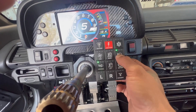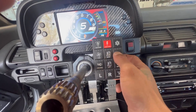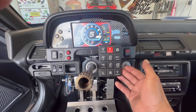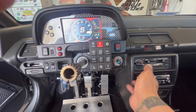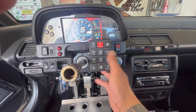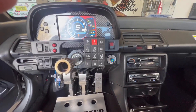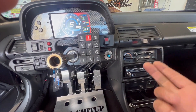Everything else is straightforward: headlights, driving lights, and brights. I have them programmed to come on simultaneously. Being an EF chassis, the headlighting isn't the best, so I run both headlights and brights at the same time. That sums up the PDM — it's pretty simple plug and play.